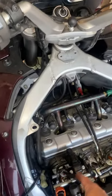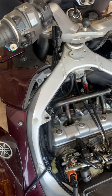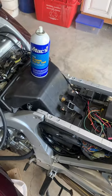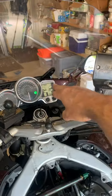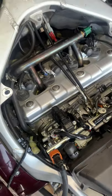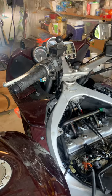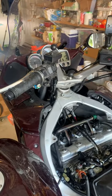Maybe I'll take those coolant hoses off and put the old ones back on. Tell me what you get on your diagnostic for the pressure sensor — I'm at 100 at 200-foot elevation. Maybe a guy in Denver's at 85 or 90 — that'd be helpful. I could try swapping ECMs, but I don't know anybody close enough to try that. Even once it's up to three bars it's still not running well. I could try syncing the throttle bodies. If you have any ideas for an 07 FJR 1300 that does not want to cold start and seems to be running lean, put it in the comments. Thank you.